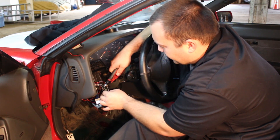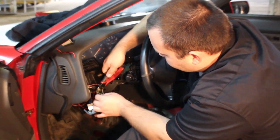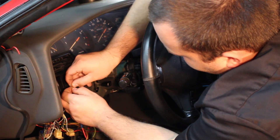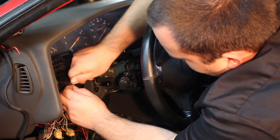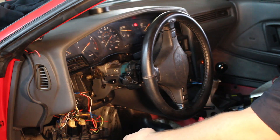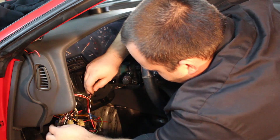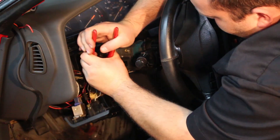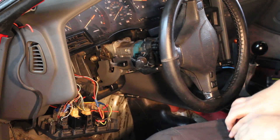This is the green power wire from the fog light switch. Make sure once again that your ignition is off so you don't get shocked. We've got our orange wire ran to the same spot — just twist these together. We're using crimps again, but you could solder if you'd like. Double check your crimp is nice and tight.